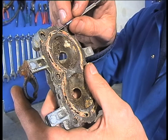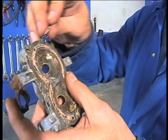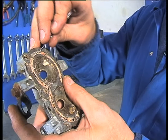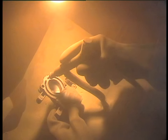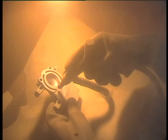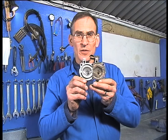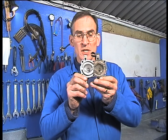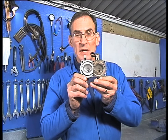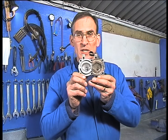There are two ways to clean out a problem like this. The salt is built up and will prevent this engine from cooling to the point where you would break a piston ring. The best way to clean these out is by bead blasting — a device that fires glass at high speed at the metal. It doesn't hurt any of the aluminium but it cleans it right down to its base. Here we can see the before and after effect: the glass bead has cleaned the casting perfectly, right down to the bare aluminium, without causing problems afterwards with painting or future corrosion. A glass bead cabinet costs about £180 and all you need is a compressor to plug it into.